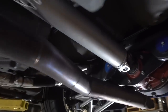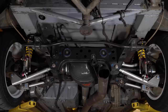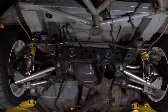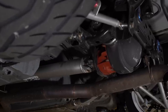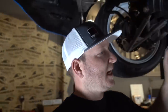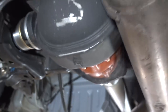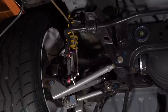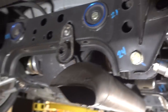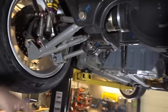One big one-piece driveshaft — Driveshaft Shop. It goes back to a Driveshaft Shop nine-inch conversion with Driveshaft Shop axles. It's a Ford nodular third member and I'm running Rave gears — Andrews actually distributes them, and it's the same process Andrews does to their gear sets in their transmissions. They apply it to a ring and pinion and these things are extremely buff. All the subframe bushings have been replaced with the Ford Performance bushing kit — off-the-shelf catalog parts — with Delrin inserts for a little bit of play.